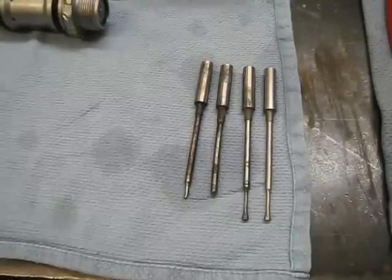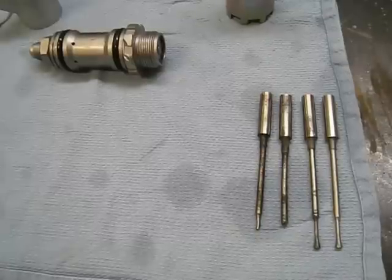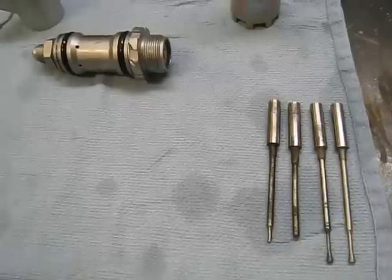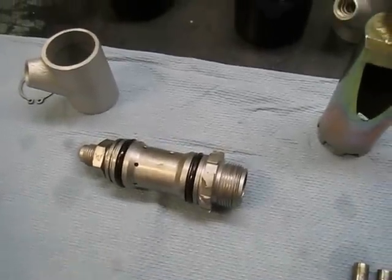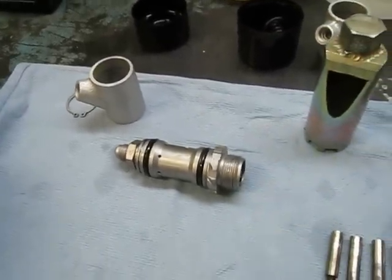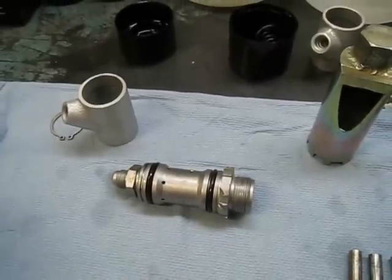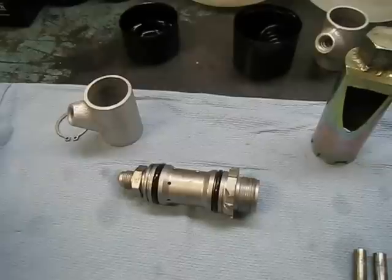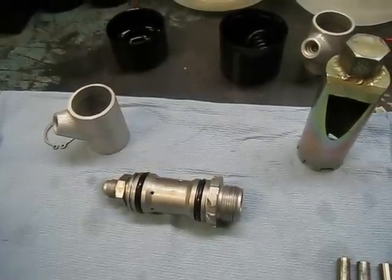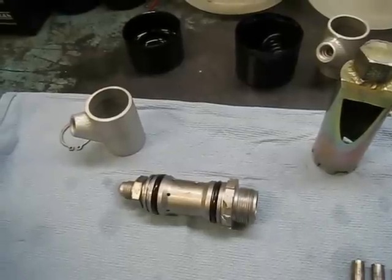The best thing to do whenever you do a brake pump reseal — there are a lot of shortcuts on this job. I see it all the time. There are people that don't even remove the brake pump; they literally just change these two seals, clean this up maybe, and pop it all back together. But there's an internal seal that also needs to be changed, and if that gets too hard it'll actually bypass leak and your brake fluid will start emptying into your crankcase. So it's very important to do the job right.